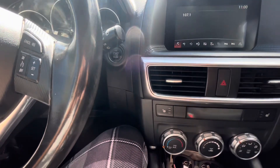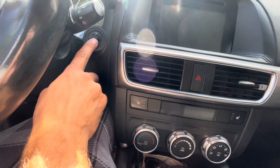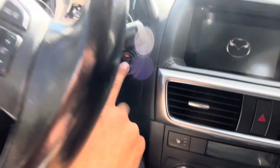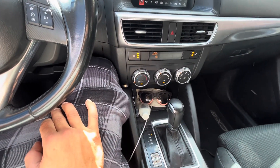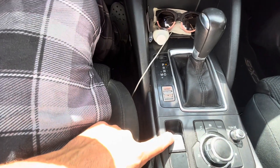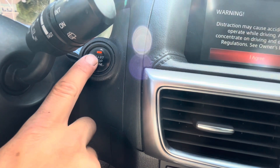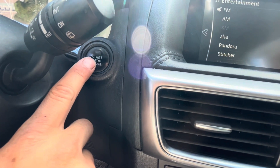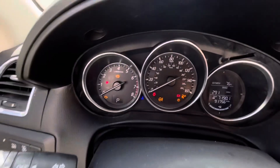Turn off the vehicle, then turn it back on by hitting the ignition twice without pressing the gas pedal, so that the car is on but the engine is not. Then put your right foot on the accelerator pedal and hold it all the way down. With that, hit the parking brake button to disengage by pushing it down. While holding both the accelerator pedal and the parking brake, hit the ignition switch three times. This is what will allow you to get the caliper off.